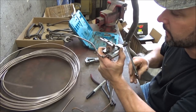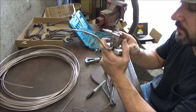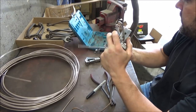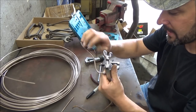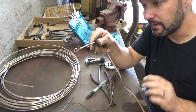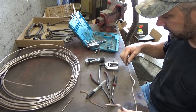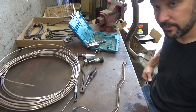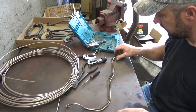So you run the die in, take the die out, make sure your flare is sitting good and straight. If it is, just run the center one down in — that puts the correct angle on it, which I believe is an inverted flare. Don't forget the brake line nut. If you make enough brake lines, one day you're going to make a beautiful flare and then you're going to look and see the nut's not there — that's going to make you upset because you've got to do it over again. So there's that line, and there's the line we took off. You can see they're relatively the same as they lay on the bench — they're the exact same length. So that should get us really close.